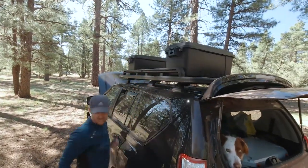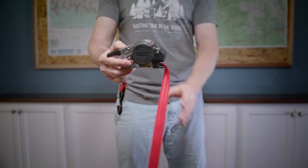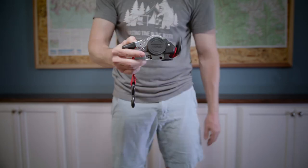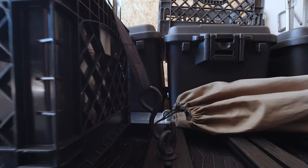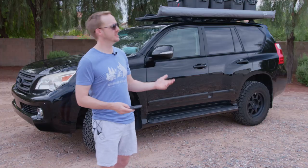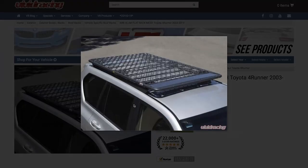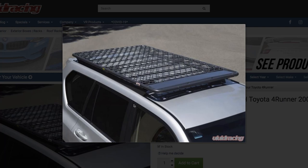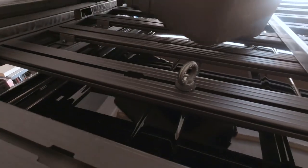Speaking of strapping them down, I switched to self-retracting ratchet straps this year. They auto-wind all the slack from the strap with the push of a button, which makes the whole process much more enjoyable. I'll put a link to the straps below, and while you're down there, be sure to hit like and subscribe so I don't have to cry myself to sleep again tonight. We secured the straps to T-slot eye bolts. To be honest, I kind of wish that I went with a flat wire mesh rack. That would have minimized the height when it's unloaded, because with a wire rack you just hook to the rack. The eye bolts are also a pain to move once the roof is loaded, because the gear can cover the T-slot access holes.